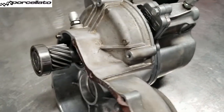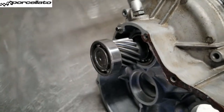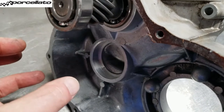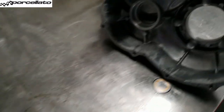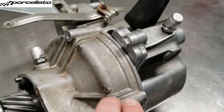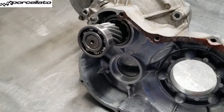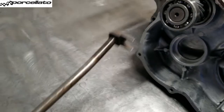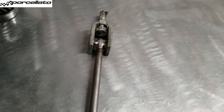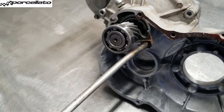So now you're looking at this assembly kind of mounted together like this. Then what I do is use a small jaw puller to get this bearing off. That allows you to get the idler and the differential out. Now you've basically got a case mounted to an electric motor or a transaxle, kind of stripped, and you've got this bearing removed. Then what you would do — and this seems to be about the only way I've found to do it — is grab a slide hammer. You might beg, borrow, or steal one from a neighbor that has some sort of an angle adapter. You want to get in behind the gear and slide hammer this whole thing out of the case.